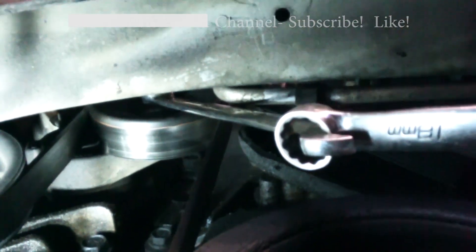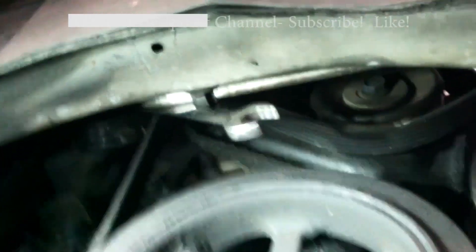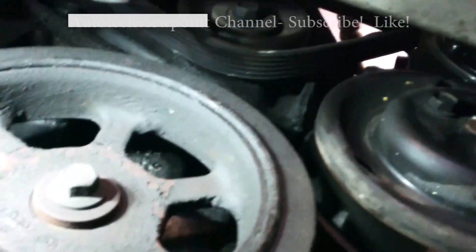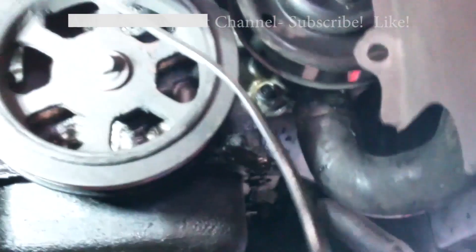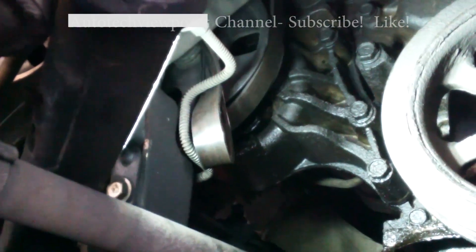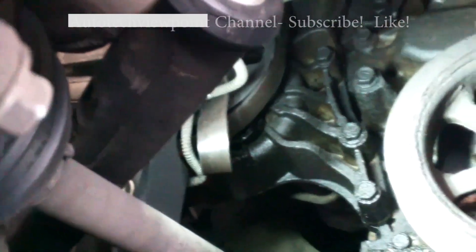Pull down and loosen the belt off. You can see this is sitting against a little plastic bracket. Now let's pull the belt off and get it out of the way, because when you spill antifreeze on a belt it'll tend to squeak and make noise and you can't seem to get rid of the noise without replacing the belt. I have a theory you could wash it with soap and water and put it back on, but if you get antifreeze on it, it's gonna make noise.